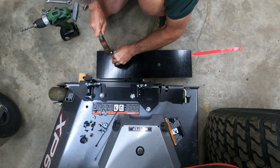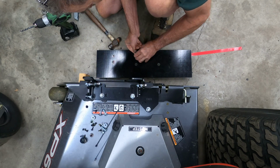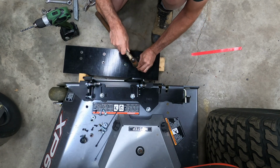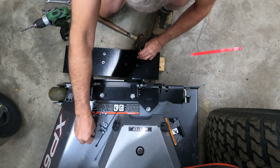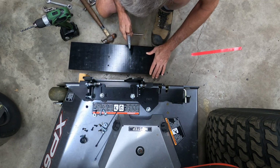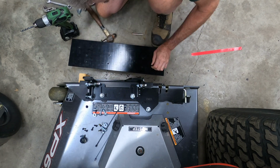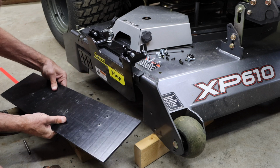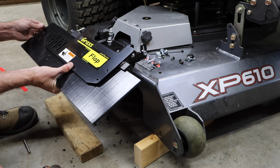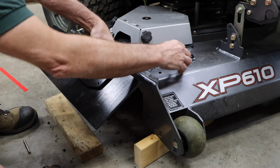There's a tool that comes with the T-nuts to let you slip the T-nut onto the end of the tool and drive it in without much work. We'll go ahead and make sure that the openings on all of the T-nuts are clear, that there's no burrs or material in them. With that done, then we're going to go ahead and reinstall the screws into the plastic blocker plate.